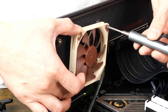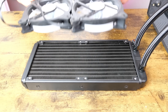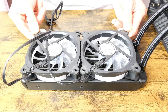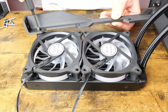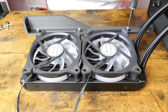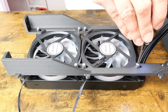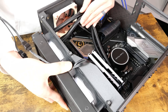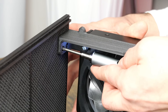I'll have the fan mounts redesigned — here you can bear witness to my fail. The sequence between radiator, fan, and bracket isn't always the same, so you can order them however fits your components. I had to put it in this order because there was a fill/purge port on the unit I was using. I'll post the screws and washers I used in the description. This is how I oriented my AIO, and yours might differ based on factors like tube length, stiffness, and diameter. The radiator brackets will attach to the top and bottom panels using screws.